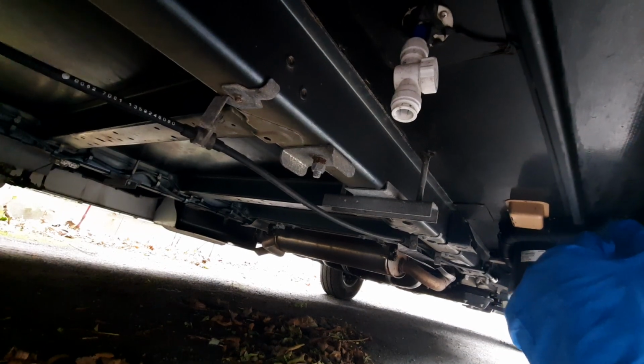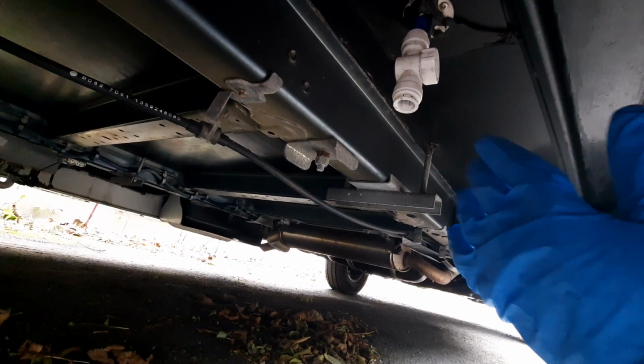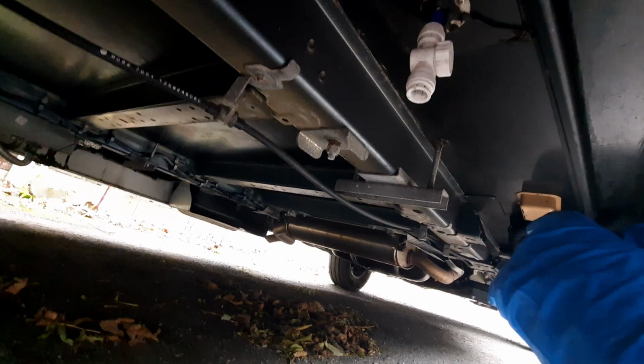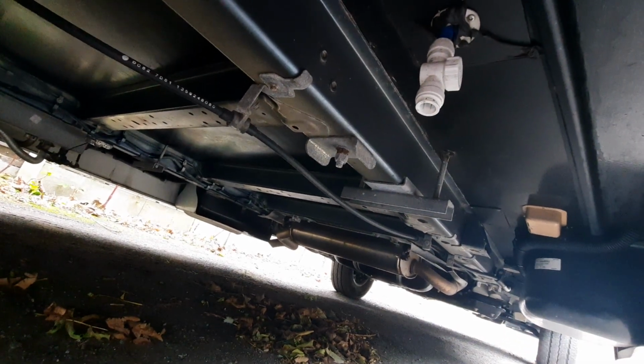And as a rule of thumb with your drain down points, what we say is leave them open when travelling, because at the end of the day it's just water which will be draining out the van, and that makes sure that the vibrations of the road are going to get all the water out for you. And that's where it's located. So dead simple.